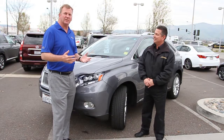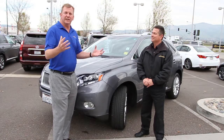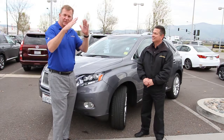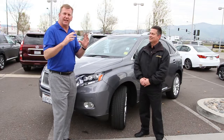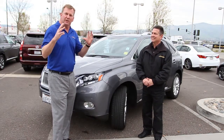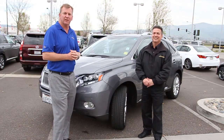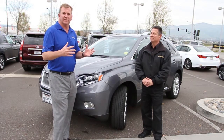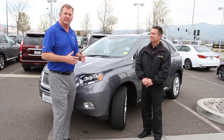You had mentioned something about checking tire pressure when it's cold. When a tire warms up, the heat makes the tire inflate a little bit more. Sometimes you'll see your tire pressure light, which looks like two parentheses with wiggly lines. In the morning you get in your car and that light is on in the dash, and then as you drive during the day, the light goes away. When it gets cold, the air shrinks a little bit, so it's typical to have the tire pressure warning light come on. So check your tire pressure. During the summer, you might check it at one level, and then a few months later, if it's cold during the winter, you need to add some air.